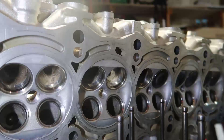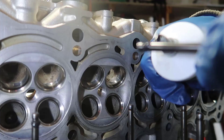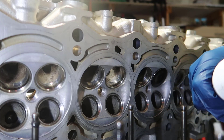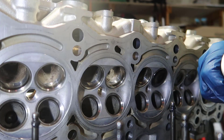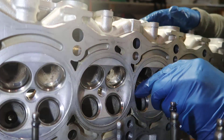If you have a long pair of tweezers it's awesome — you just drop them in and you're good to go, no wasted time. So what I'm going to do is put all the valves in at once. I already cleaned them up, I'll get assembly lube and put it on all of them, put them all in, then I can lay the head flat on the table and not have to keep rearranging everything. Let's do all of it at once.